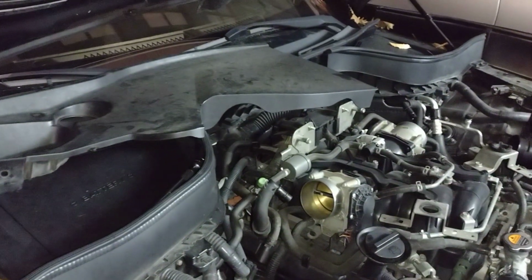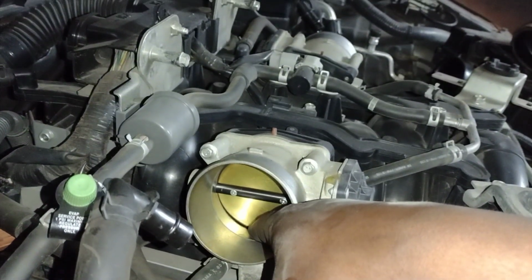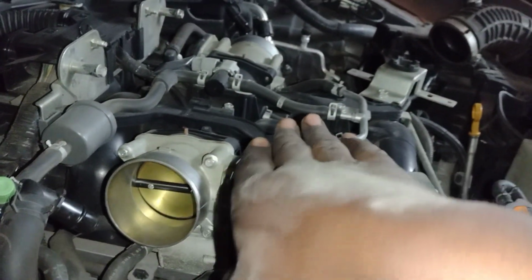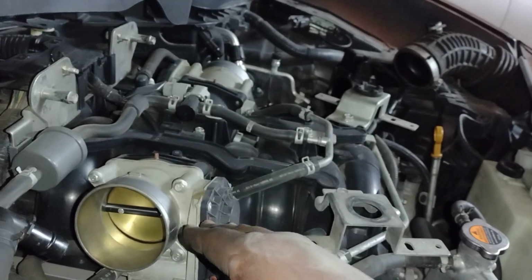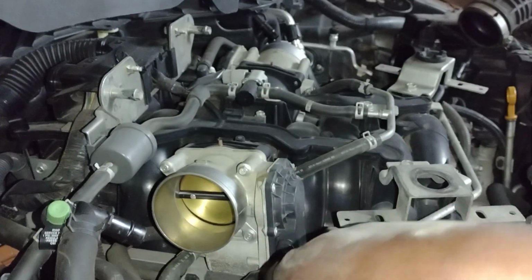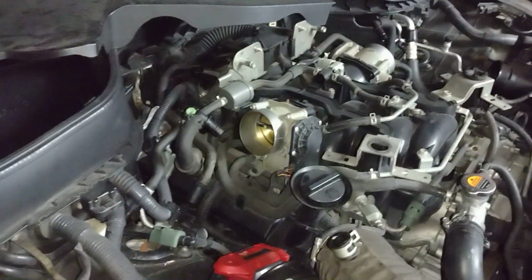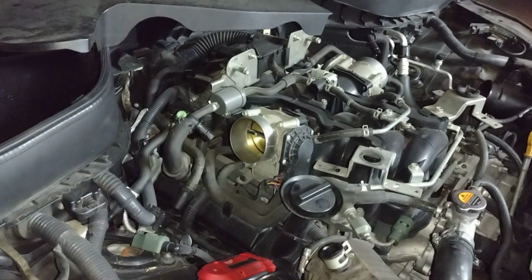And that's another discussion as to why throttles don't open all the way. Right now, as you can see, this is a closed position, but it's not fully closed. There's a little bit of a gap. Just a little looseness there, right? And when it opens all the way to fully open, it's not 100% straight either. That's more of a fluid mechanics problem at that point, because you don't want the throttle to end up floating and being unresponsive because the air is holding it all the way open. But, different discussion. Right now, as I said, I was just curious, and I figured maybe that would be a cool video to show.